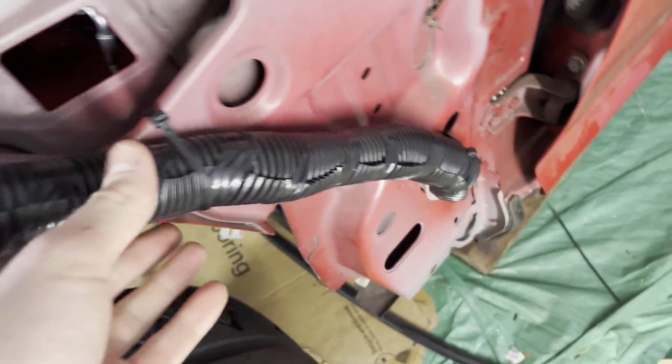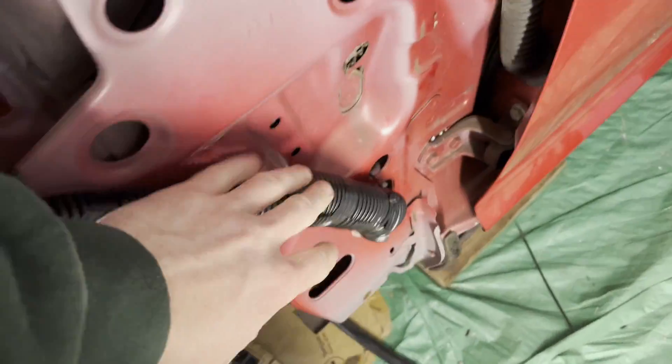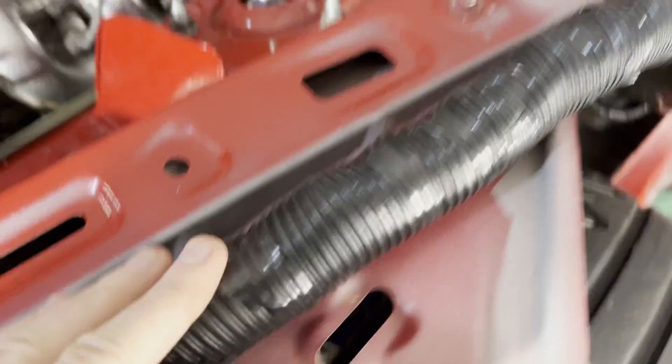Back in the garage — I didn't want to let this video get too long, so I went ahead and finished all the wiring off camera. I'm thinking tomorrow this thing is going to be outside, maybe even on the ground tonight. Here's what I got done: I finished up the driver's side loom — I'm going to wrap it in tape to seal it since it'll get some water in the wheel well, but for now it's partially taped until I make sure there are no issues.